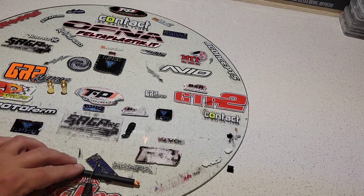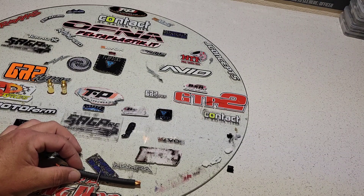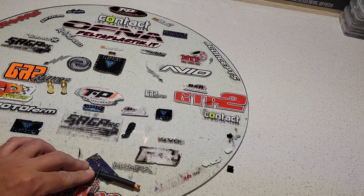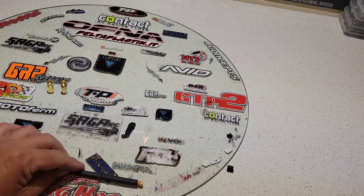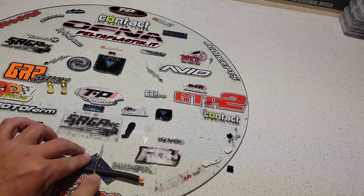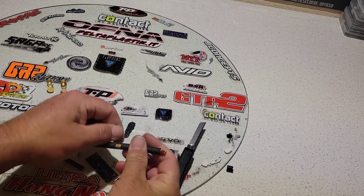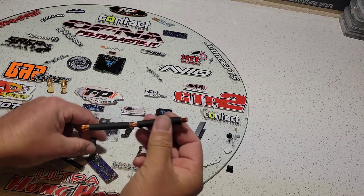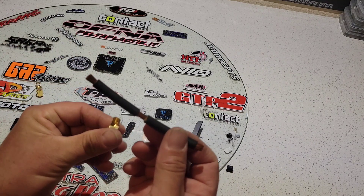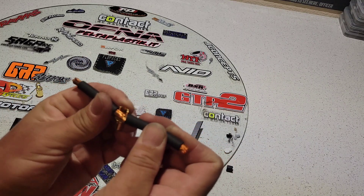You're going to make a cut in the center — that's just your center mark. Now go five millimeters on each side from that cut. Take it and cut that sleeve off. Now you have it open in the middle — this is why I cut the bullet in half. You're going to tin this, solder it, and shove that half bullet right up in there.